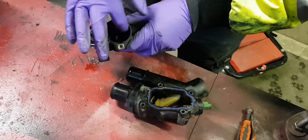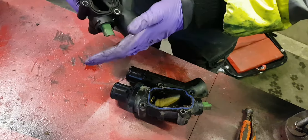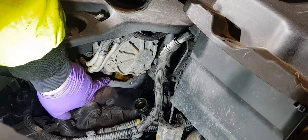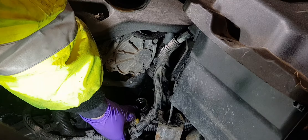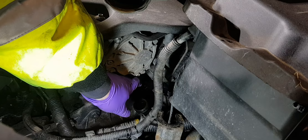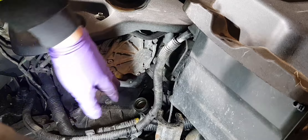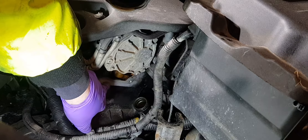I've got a fine piece of emery cloth and I'm just going to clean the surface up. This is the new thermostat housing — you can see it's an exact match. I think it was about £50, plus the antifreeze which was an extra tenner, so £60 all in. It comes with a new temperature sensor. The only thing I do when fitting it is use some rubber grease — grease that's specific for rubber. I smear a little bit around all the gaskets, such as the rear pipe, and around the rubber gasket, so they help to seal but also help push the hose back on without it getting stuck and risking tearing the hose.